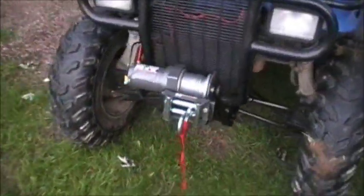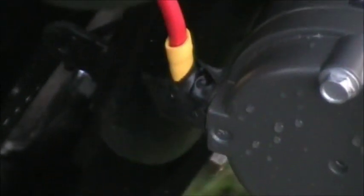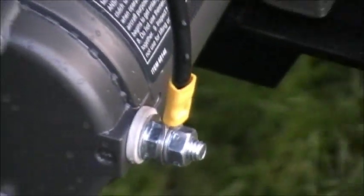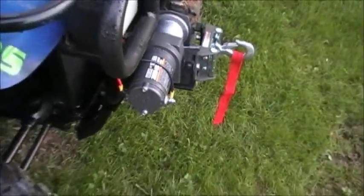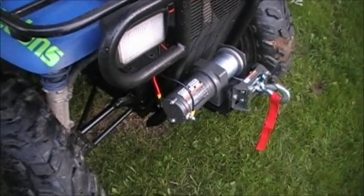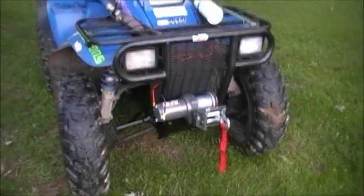We're completely done now. The only thing I didn't like is that no covers came with it for the wire ends, so I black-taped them for now. I'm going to get spark plug boots or something similar to go over the ends because I don't like them exposed — I don't want anything to rub against them and arc out. I suggest you guys do the same thing, because if a piece of metal arcs against them it'll short out your whole system on your four-wheeler, and that's not good. That does it for this one — I'll show you how we assemble the plow next. Talk to you soon!